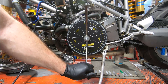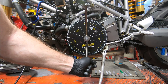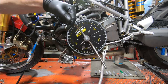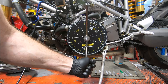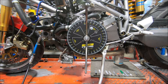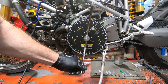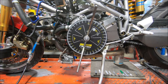I'm curious, I might go to the other side. I go four degrees past — nope, didn't like that. Back to compression. Try three — didn't like that either. Does this mean my TDC is inaccurate? I hope not. Three degrees this side — there we go. Maybe it just needed to move a little bit.